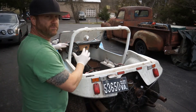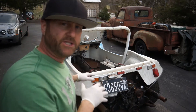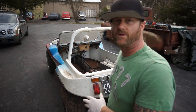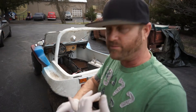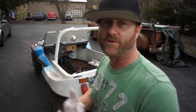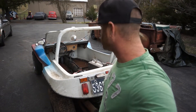Let's see if we can get it running for the first time in over a decade — the guy I got it from never got it running, and it had just been sitting with leaves and debris everywhere. I cleaned it out the other night and yanked the seats out to check the floor pans — it's a solid, solid unit. If this motor turns over, it's a perfect candidate for new plugs, wires, cap, rotor button, points, and condenser, then clean the carburetor and put some fresh gas in.